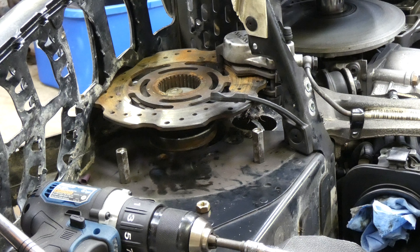Now the rotor is free, but that's not really the problem here. We need to pull the caliper, and then the rotor will come off with it. Using a T40, you've got to align the rotor so that the wide spaces give you room to access the bolts underneath. There are four bolts, and you'll notice there are four wider spaces on the rotor. Turn it so they're all aligned, and then the bolts come right out. Start each one by hand — they're in there pretty tight — and then once you start it by hand, you can pull it out with the drill.